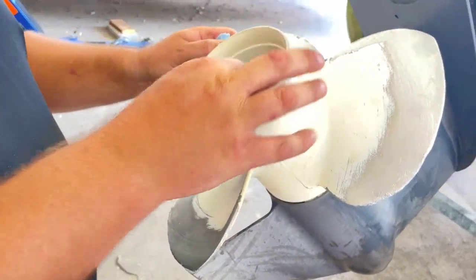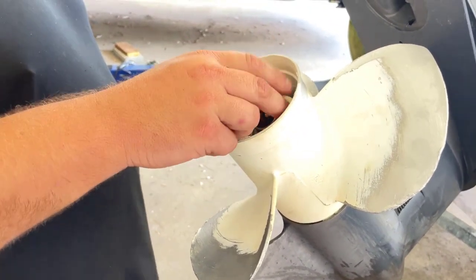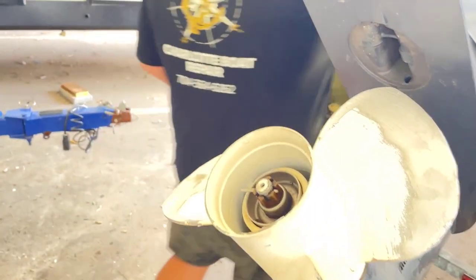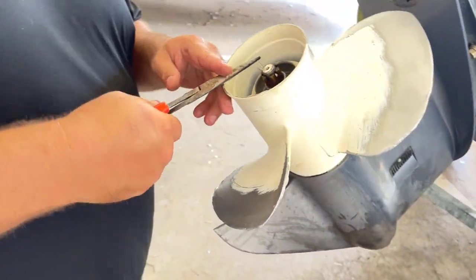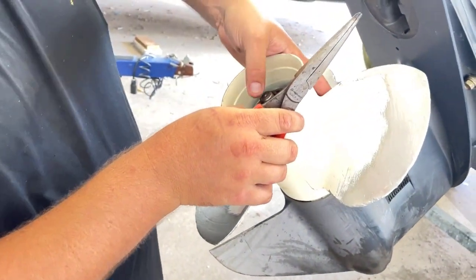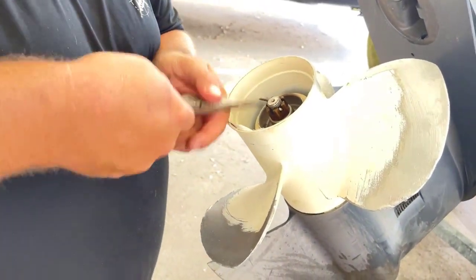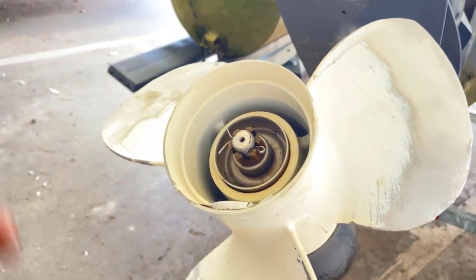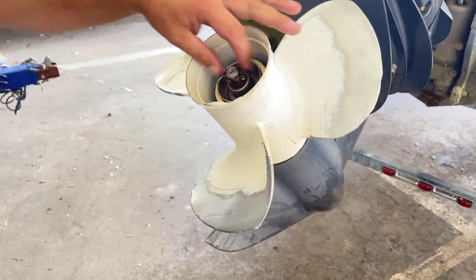Again, another reason, if you're a boater, do these inspections before you hit the water. And you might catch a bad mechanic, just someone that's not giving you a good service also. Yep. So knowing what that should look like, and knowing that 10-cent cotter pin could keep me from breaking down on the water. And then again, you see how Mike is kind of bending it and then bending it again so that it's not something to get hung up on or catch a toe on if you're swimming, and bending it in a way that's locked on good and tight. But it doesn't have to be all the way over either, because that makes it a pain in the butt to get it off. So that ain't going anywhere.